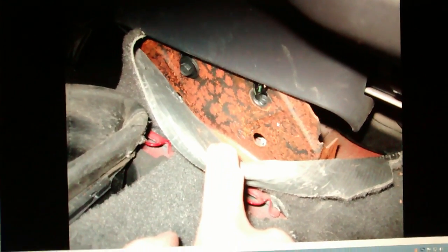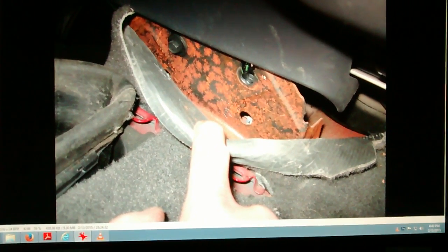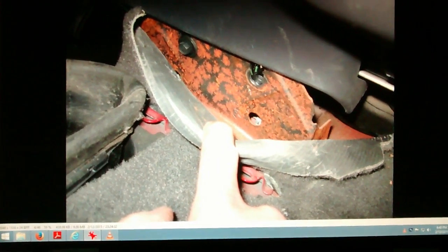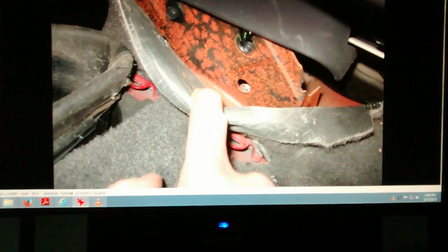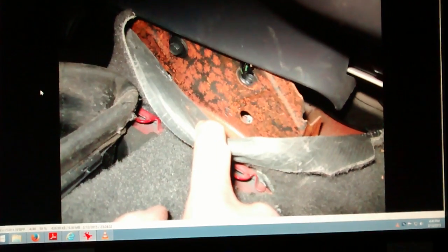Okay, some pictures I took. Here's a picture of the bracket on the center. There's the 2 bolts on the front that hold the metal bracket to the dash, and then there's the 1 bolt down here, and then there's the 2 over here that hold the metal bracket to the frame. Here's a picture when you're looking on the passenger side down onto the box. There's the one line where the air tube goes to the dash, and then here's your blend door connection from your cable, which of course you're just going to disconnect from the front.